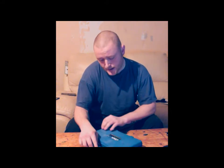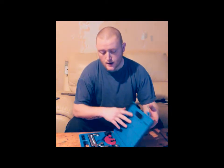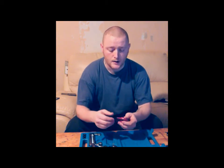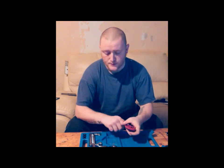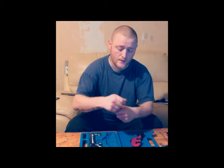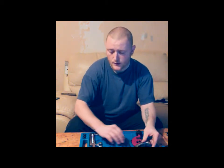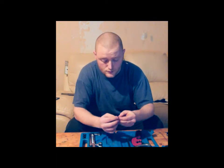This one's made by Laser. It's a 2943 10-piece flaring kit. You've got a standard pipe cutter with a little thing in the end to clean the pipes up once you've cut them. You've got your yoke, your flaring cone on the thread there. These always come pre-wound so they fit in the box. So we'll start off unwinding that all the way out. You've got these various sizes of punches or mandrels, whatever you want to call them.